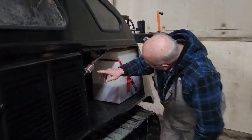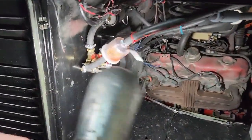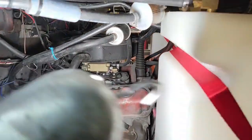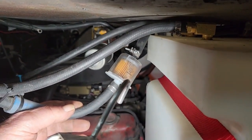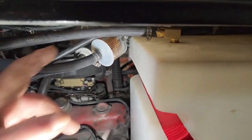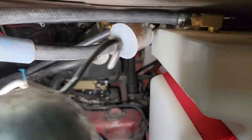See how the fuel is running here? This is the other fuel line now — we'll switch. See it pumping? Looks good. So we know it's pumping on either tank, plus the return is going steady because the way this is set up, it returns to this line or this tank.